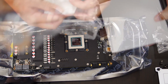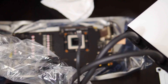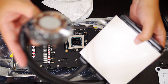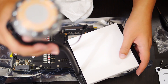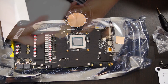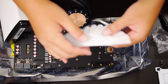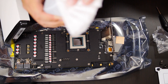We're just going to clean this off and prep this as well. The next thing we have to prep is the cooler itself — this is the Corsair H90, which is a decently old model but I've always had success with it. This is what's been cooling a 3770K i7 processor for the past two to three years, so I decided to go with this. It also has a 140 millimeter radiator. Now we have to take off this cap and clean off all this thermal compound because I want to apply my own. As a final measure of cleaning, I'm going to go over all three surfaces again using a coffee filter, because supposedly a coffee filter will not leave any fibrous residue like paper towels would — a tip I got from the reference video.